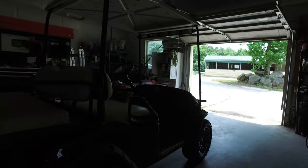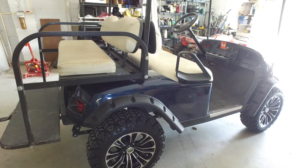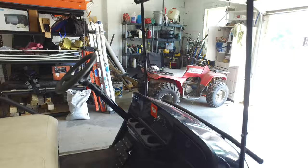On the other side you have the new fender flares — a fairly easy install, also ordered from Steeleng Manufacturing Company for about $70. They're plastic with six screws in the rear and four screws in the front; I piloted the holes before putting them in. Up here you have the five-way mirror, a $20 order from Amazon — cheap, but it helps with street legality.